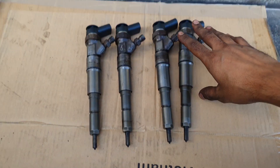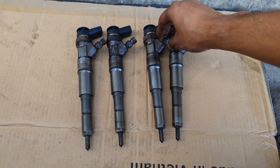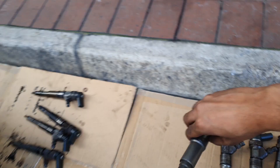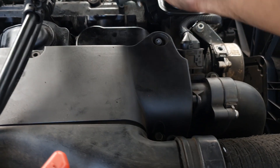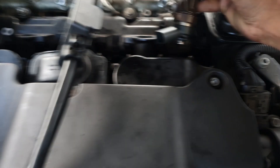Let's get to replacing them. I have my new set — and I use the term 'new' very loosely — these are from a second-hand vehicle that's being junked. They apparently are working, so what I'm going to do is flip them around in the engine bay facing upward so we can test the spray pattern and confirm everything is spraying evenly before putting them into the car.